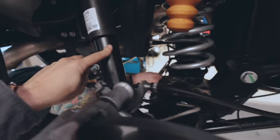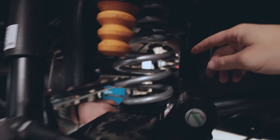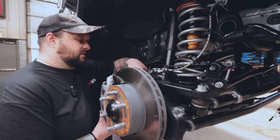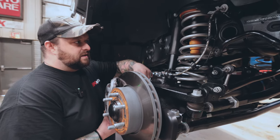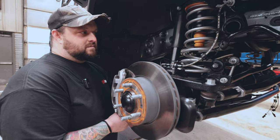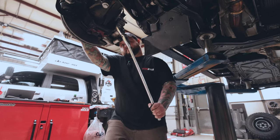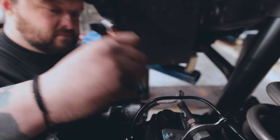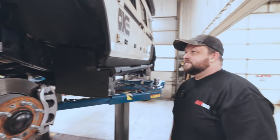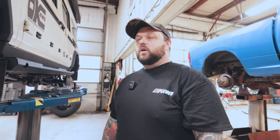We tightened our sway bar, got our shock back in place, and also snugged up the control arms. We're going to double check those once it gets over to the alignment rack. Dave is just working on brake lines, getting the upper and lower bracket back in place. We're going to have to do the end links, control arms, and track bar on the rack to torque them — it's better to do it on the ground at ride height with the vehicle's weight on it. Just about done; now I have to put the wheels on and get her on the ground. It required a little more disassembly than initially expected, so it's just a little longer of a process.